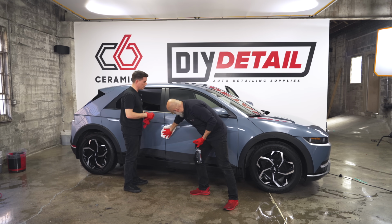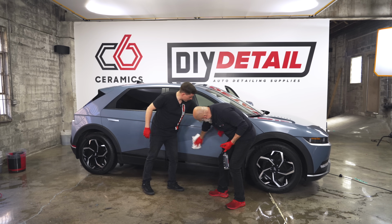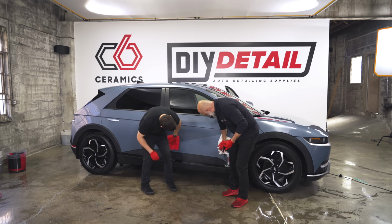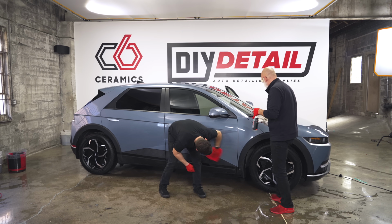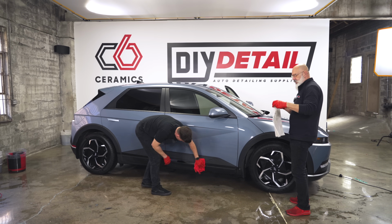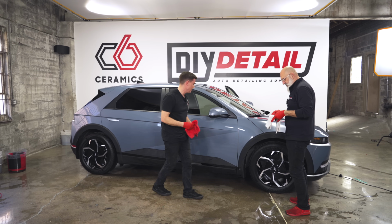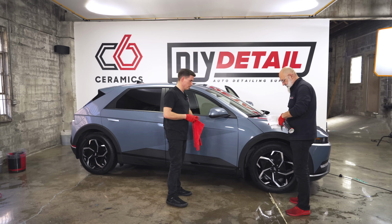Let's say you miss the polish the first stage, and you end up using panel prep right over an area that still has polish on it. Is that going to be okay? That's going to be perfectly fine. That's one of the other reasons we want you to use panel prep. It's not going to react on the surface and cause a nuclear explosion? No, not at all. Not even close. But it is going to make sure that you've got a nice clean surface ready for the coating.